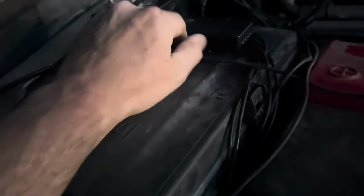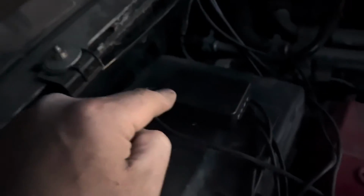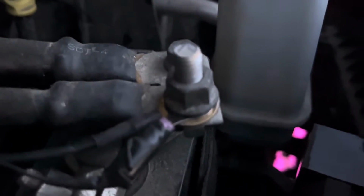When you pull the wires up, this is the control box. It comes with a piece of double-sided 3M tape, and I just stuck it right to the fuse box, so it's fixed really well. The end connectors, you just plug them in. These are watertight connectors, which is nice. The only thing the kit doesn't come with are terminal hooks to go around your battery. You don't want to use bare wire on your battery, so you're going to want to pick up some terminal hooks with the correct gauge and then run it.